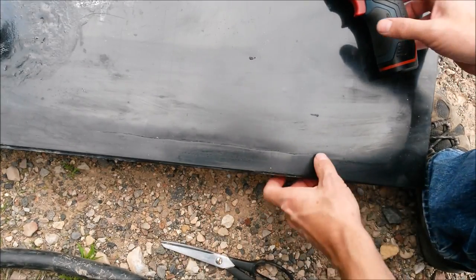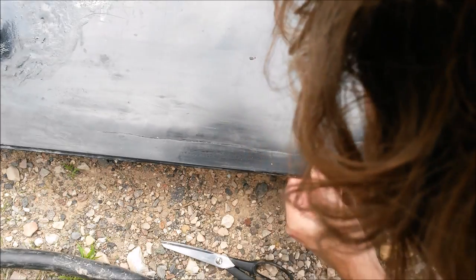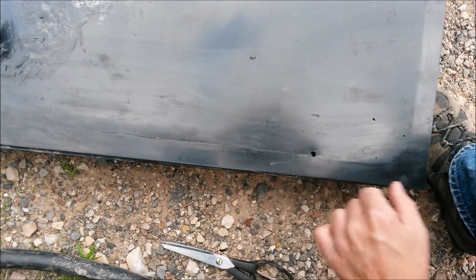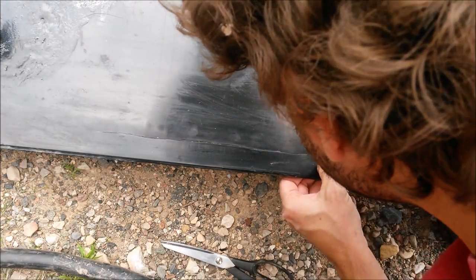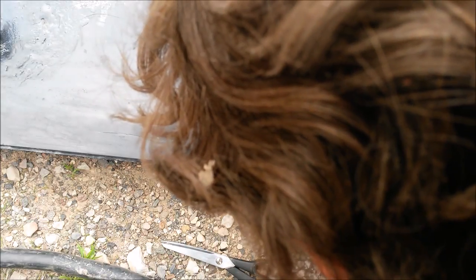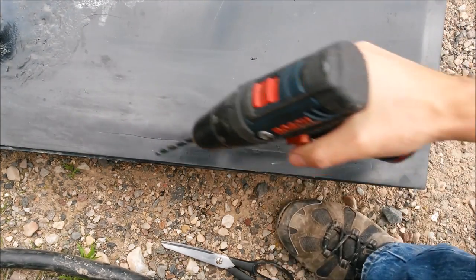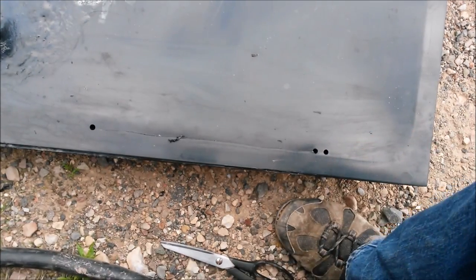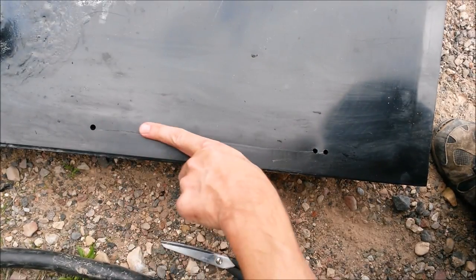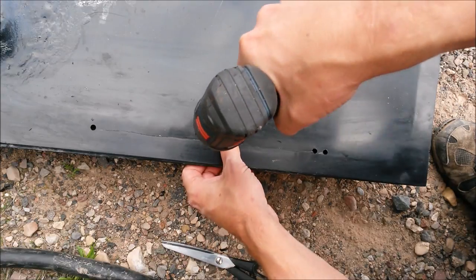What I'm gonna do is go to the edge of the crack, go about 1/8 of an inch past it, and drill a hole. It actually just continued past that because I kind of bound up the drill bit. We're going to drill another one out. There we go. That basically stops the crack from spreading. It relieves the stress so that if this continues to flex, it's not going to keep cracking past that. I'm going to do one in the middle just to have a little hook.